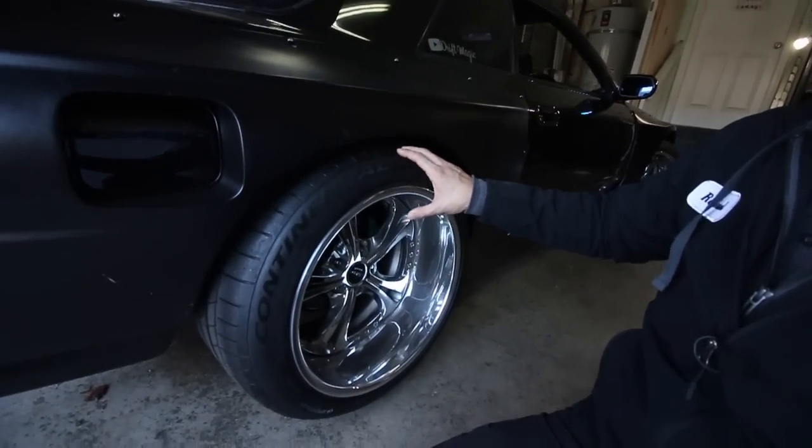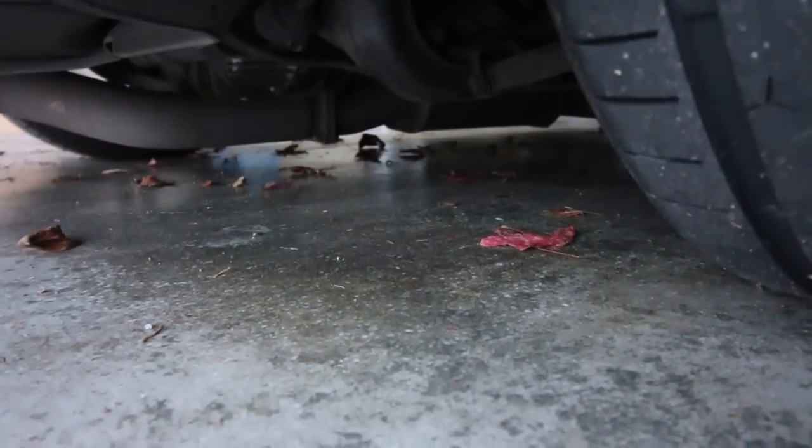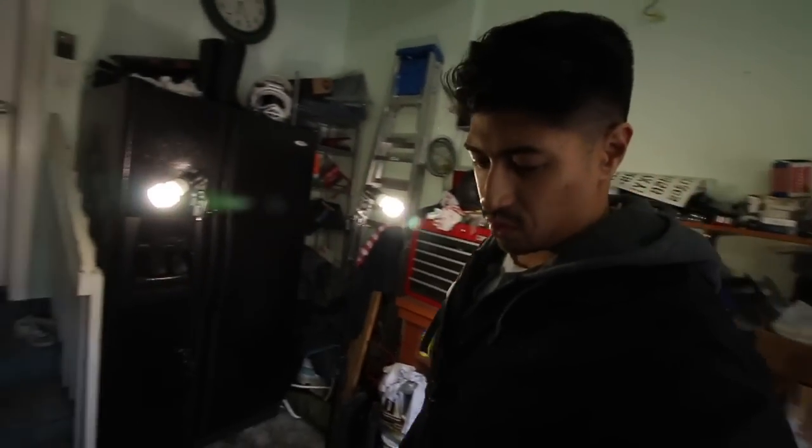Overall, the car was already low, and I dropped it another 2 inches from that height. So I literally maxed out my coilovers, and I needed to get some of it back height-wise, or else I wouldn't clear. It would be too low to drive normally. If you look at my clearance below, because of that, it's actually doable. My exhaust is the lowest part, and even that is pretty low. I don't scrape on much, maybe some really tall speed bumps, but that's about it. As far as rubbing, I have a little bit on the plastics, so I had to remove some of them. Other than that, she's pretty good.